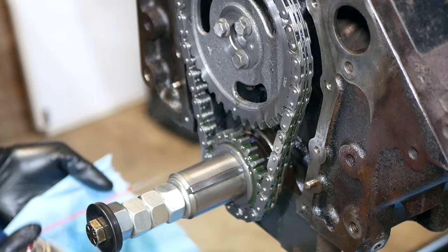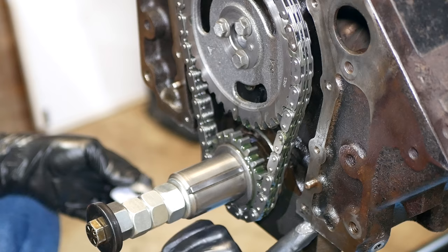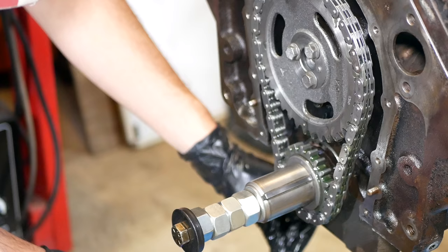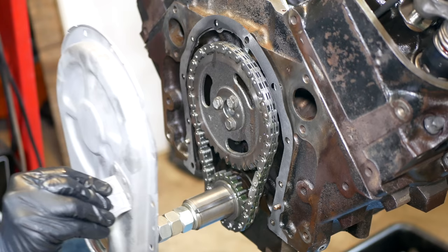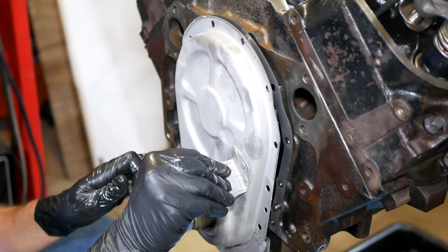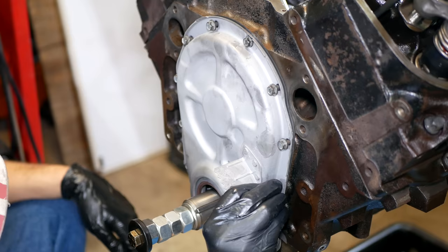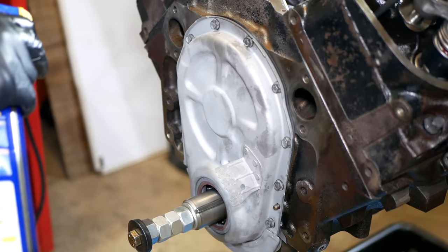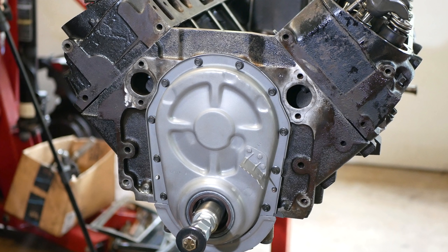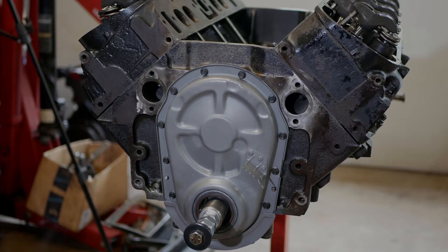With the seal sitting in there nicely, we'll clean up the excess Loctite and the cover is ready to be reinstalled. We'll make sure the block is clean where the bottom of the timing cover meets it so that we can add a little bit of RTV to seal that gap. We'll be applying a bit more to the corners when installing the oil pan gasket, but applying some now that'll get clamped under the cover is good for a little extra security. Then we'll take the paper gasket and spray it down with WD-40 to make it a little bit less likely to stick. We'll slot that into the dowels on the block to hold it still and carefully slide the cover over the crankshaft, get the first bolt started, and work our way around to install the other nine — all snugged down in a crisscross pattern and then tightened to 96 inch-pounds. With that, the cover is fully installed. We were able to get a lot done in this episode and we're coming out of it with a complete long block, but we're still not done — the next episode will be covering even more of the reassembly.